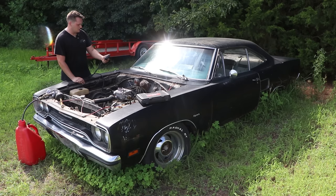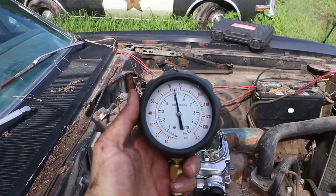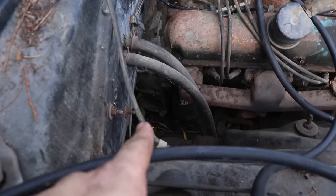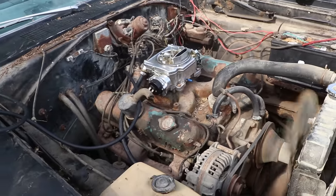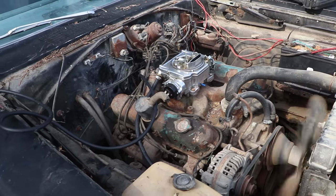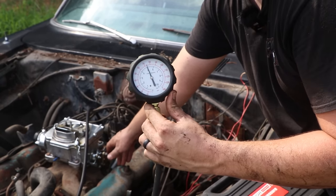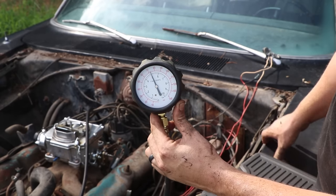I'm showing 75 PSI at the gauge. This thing has coolant in it, so I'll just let it warm up. Look at that - 75 PSI just sitting there idling. They might have put really thick oil in it, like a 20-50 or something. They did change the oil - there's a new Wix filter down there. It just sits here and idles. It really honestly does run very well. It didn't smoke at all when we fired it up - that's pretty solid. Let's see what kind of pressure we get when it revs. It does increase. That's a healthy engine.